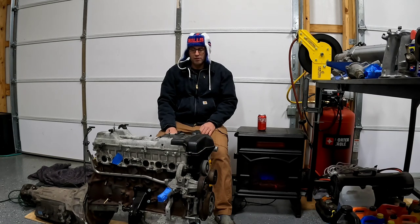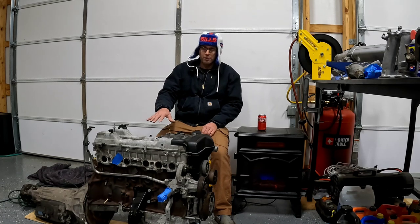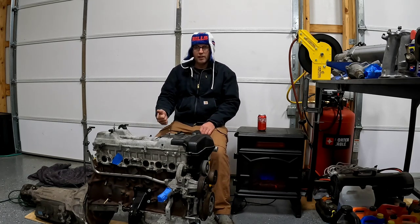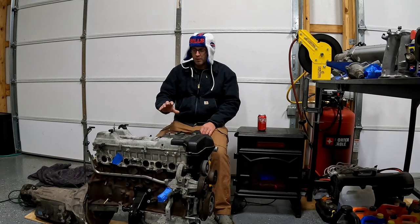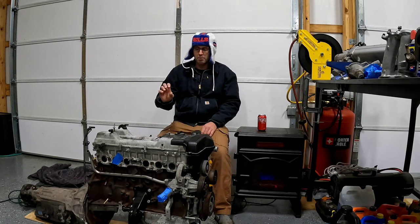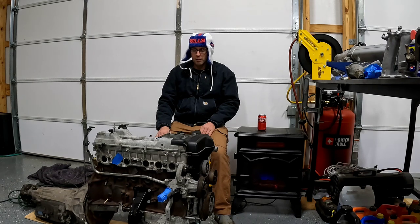The earliest version of the 2J was called a 2JZ GE. Those motors didn't have variable valve timing and they had a regular distributor on the side. What was cool about those motors is they had essentially the same bottom end as the later turbo motor. What a lot of people like to do is buy the motor that I have, take the head off of it and put it on that old GE motor. Really the only difference between my motor and a GTE turbo Supra motor is it has different pistons, different rods, and a thinner head gasket. When Toyota built the IS300, they wanted to use the same proven engine but didn't want to turbo it, so they put higher compression pistons and a thinner head gasket in it. The block is the same, the crank is the same — it doesn't have oil squirters, but a lot of people that build the turbo motors delete the oil squirters anyway.